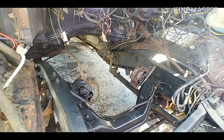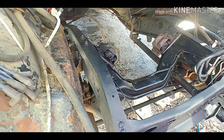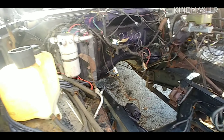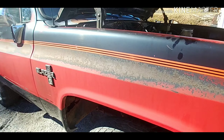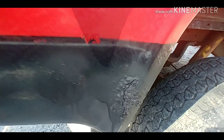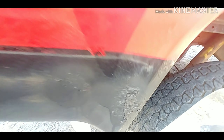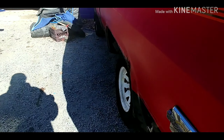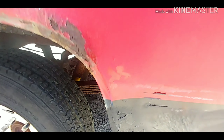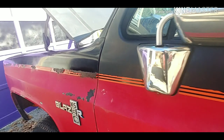I'm giving you an update on what we got here. I sprayed that rust neutralizing stuff on here the other day that I showed you guys, and then I went over with a black rust reformer from Rust-Oleum. I'm gonna get under there later on today, but I sprayed this little corner right here down real good, and it neutralized the rust. I wiped everything down real good with some engine degreaser. These are coming out pretty soon — I'll probably get working on those, but I'm real happy with the way the frame turned out.